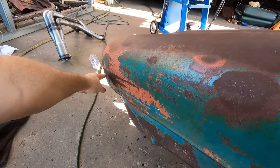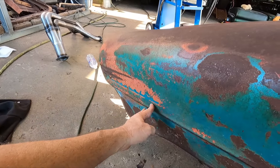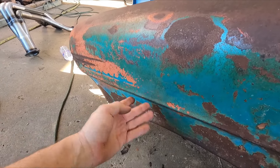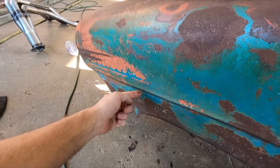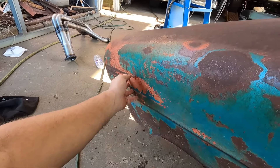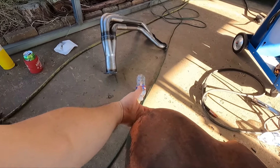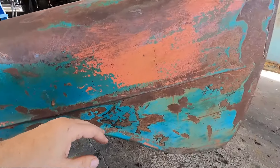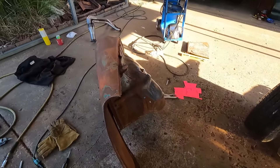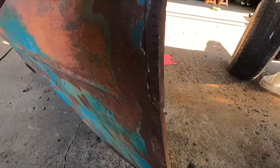It was caved in right here all the way through here, so I hammered and dollied a lot of it and I've still got a lot more to go. I've got a low spot right here in my body line, so I'm going to take a piece of plate steel, soften the edge, lay it in behind there, and hammer it to try to knock that back out. I dollied and hammered around up here and got some of the high streak out of it - it'll end up looking pretty good. The headlight front is still good; it just has a couple of dingers and a little bit of rust underneath the flange. Otherwise the fender is not too terrible.